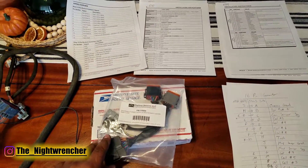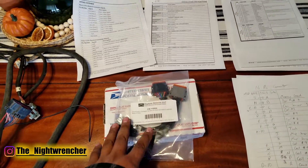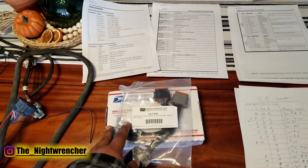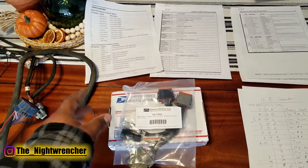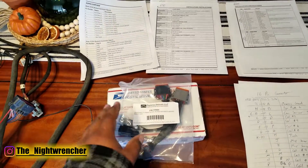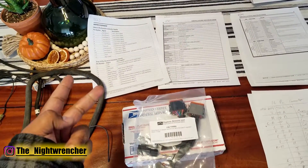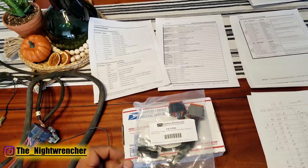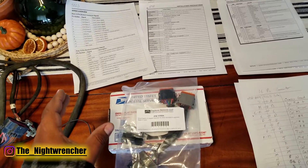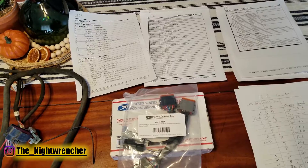What's cool about switching over to the SSLS from the 6014 is it gives you the ability to add an external MAP sensor, so you can change the sensor to whatever you want. On the 6014 you were locked in to the built-in sensor, and if that sensor went bad you had to replace the whole box. The 6010 and 6012 are now discontinued, so support is pretty much non-existent, and we're stuck finding a way to get that 6014 harness to work.